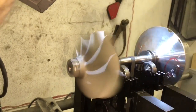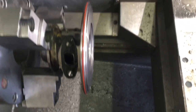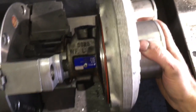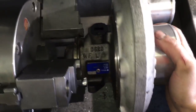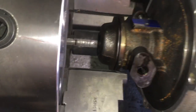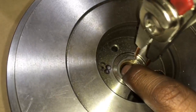If you want to purchase that rebuild kit — the same one that we use — I will link to that in the description box. If you want us to balance your assembly, we can also do that as a service. I do machine out the bearing housings for this compressor housing o-ring for our rebuilds. If you wanted to do that for your turbo, you'd have to either send it to us or to somebody that could do that work for you. The bearing housing has to be machined for the o-ring because it never came with a gasket from factory, so if you want a gasket there, you have to have this o-ring there.